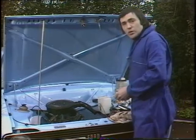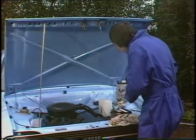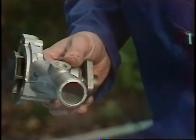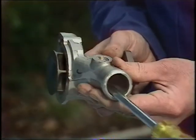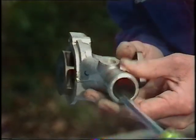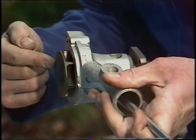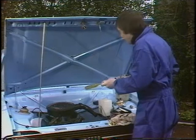Perhaps it's the water pump that's letting you down. That is the water pump down there, and I've brought another one along so you can see it. To check whether it's letting you down, take the hose off, put a large screwdriver up and hold it firmly in, then turn the water pump over by hand on the fan pulley or water pump pulley. You can feel through the screwdriver whether the impeller is moving round. If it isn't going round, then you've got to change the water pump, which is a fairly simple and straightforward job.